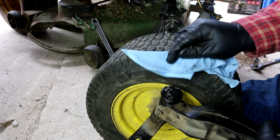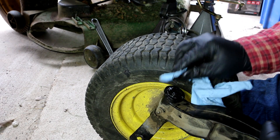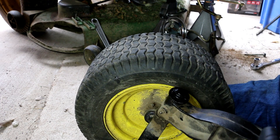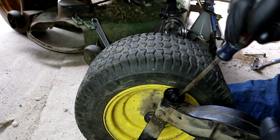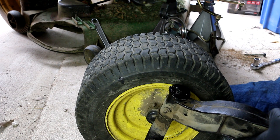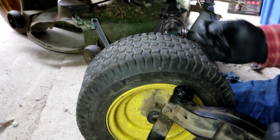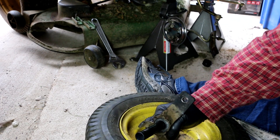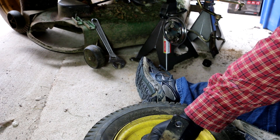It's likely full of grease, so we'll get a shop towel or rag and try to get some of the grease off. Then with that same straight screwdriver, stick it in here — there are spots on either side where you can get a screwdriver in — and just pry this off. That retaining ring just pops off, then you take the washer off and it slides right out.